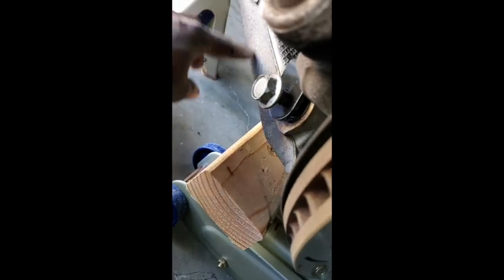Back in, you're gonna have to compress this a little bit. Just move it up, maybe. For me, it's like 1 pump of the jack, so it lines up the bolts at the top. Just thought I'd give that tidbit of advice, just in case someone's trying to figure out how. But that's it. Also, make sure that the cable is going off the back here and going backwards, and not off to the side, or it's not gonna reach the little holes that these 2 pieces go in to stick it back up into the frame. So yeah, I think that was the final add-on, but let's button this thing back up.